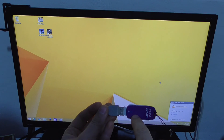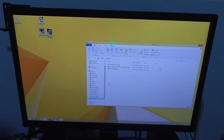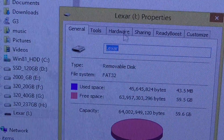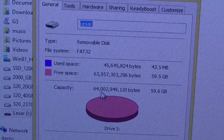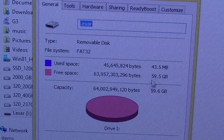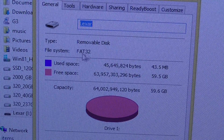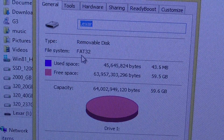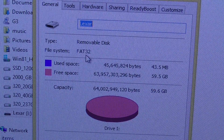There's an LED here. The drive's label is already called Lexar. Let's go to Properties — we have 59 gigabytes out of 64, so only 59 are available. It's already formatted as FAT32, which is not ideal because FAT32 won't allow files larger than 4 gigabytes.